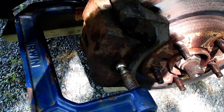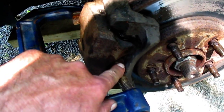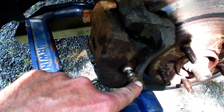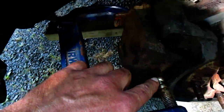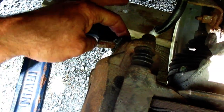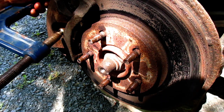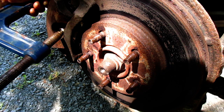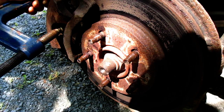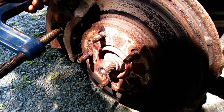I actually have a video on this — I've replaced the brake pads, so we're not going to be replacing the brake pads in this video, just the rotor. Place your C-clamp strategically on the brake pad in here; you see where the end of it is resting on the brake pad. But you want to be very careful in behind because there's a fair bit going on right in this little area, and you want to make sure that the clamp is against the steel of the brake caliper, not on the back of this flex hose. And you want to watch out for this bleeder valve.